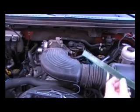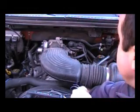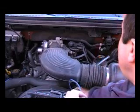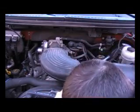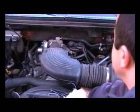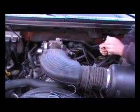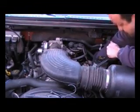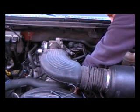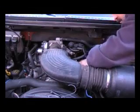We're going to take the same thing — side A facing towards the coil — and go under the air intake duct along the top of the valve cover to start with. We're in the way a little bit to get it in position. Again, making sure we don't let that flip over on us. Then we're going to take and wedge that stick in between the valve cover gasket surface and the coils. This side's a little more tricky — you've got to make sure that little button slides itself down in between, and you've got to bend it just a little bit to get it up above the valve cover gasket surface so it gets down in there good.